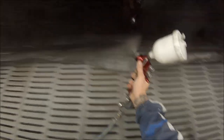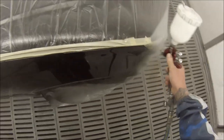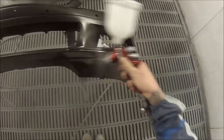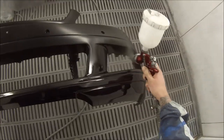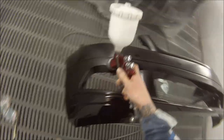You'll notice when I'm putting my clear coat on, I actually don't stop at the edge of the panel. I paint slightly through — you can see on this fender I'm not stopping at the edge where the gap to the door goes; I'm actually painting through those gaps so that you don't get a big build-up there. Painters will know what I mean — you're better off flicking it just off the panel, though you do have to be careful you don't get big build-ups off the panel either.